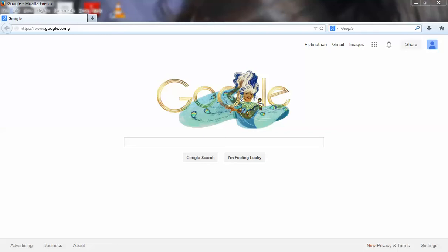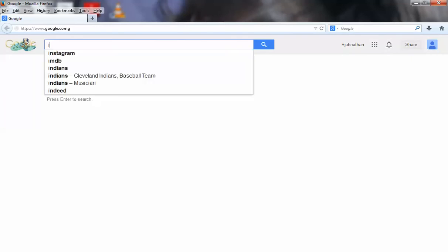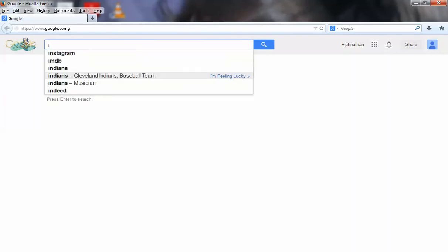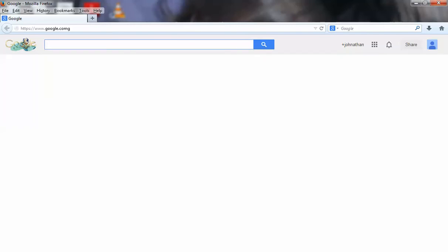So with port forwarding, basically your device is going to go to a port on the router, and when you're outside the network, whenever you have this set up, let's say your port is 8080, you're going to be connecting to your IP address. You can find out your IP address really easily by going into Google and typing IP. I'm not going to do it on here because I don't want my IP address exposed, but if you just type in IP, it'll bring up your IP address right here. If Google's not working, there's plenty of websites like whatsmyip.org, I think. All kinds of different websites out there work, but I just use Google. So you find out your IP address.